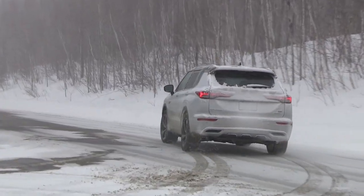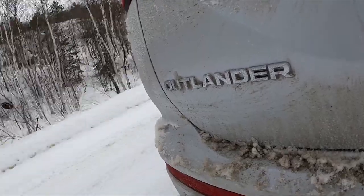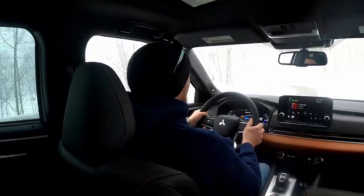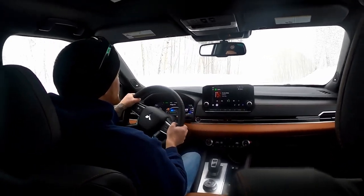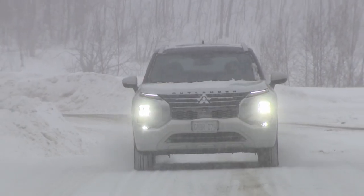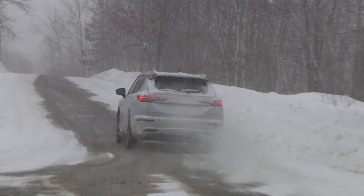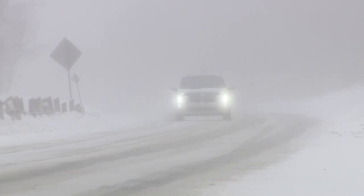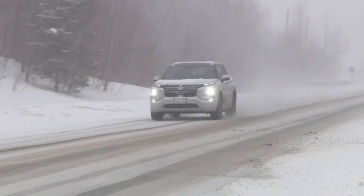Building on this confidence is the machine's performance on snow and ice. Active yaw control uses some front wheel braking in response to cornering, giving the front wheels a strong foothold as torque is split and vectored by the AWD system in real time. The overall drive on slippery surfaces feels highly obedient, predictable, and surprise-free. Attentive drivers will even feel power delivery and the AWD torque split adjust beneath them in response to bumps on slippery roads, reducing the tendency to fishtail or plow straight ahead before those situations occur. The AWD system is also largely free of lurching, spinning, and binding sensations.